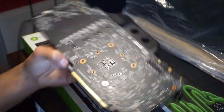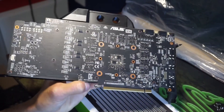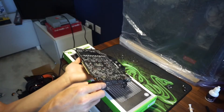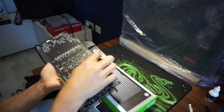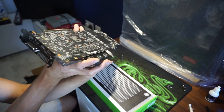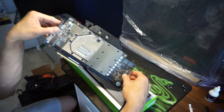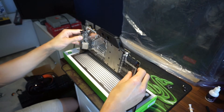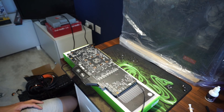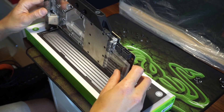All 13 screws are now in — four around there, a couple around there, and so on. I haven't tightened them really tightly, just hand-tight. I've put the two blanking ports in there for now, and if we flip it over — it stresses me out not having a backplate on there, so I think I'm going to go ahead and get one. There's the front of the block. I've still got a whole load of screws and washers left over in case I do get a backplate. Thanks for watching my how-not-to install a GPU water block!